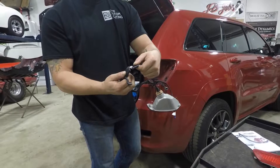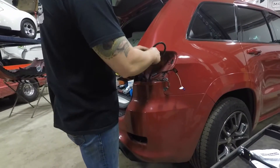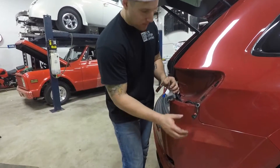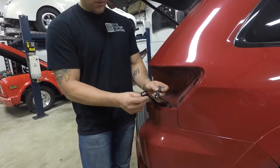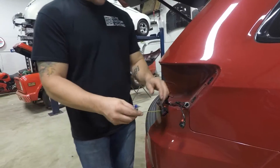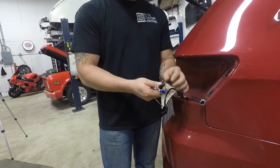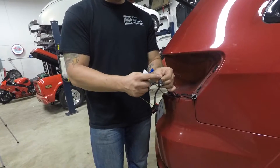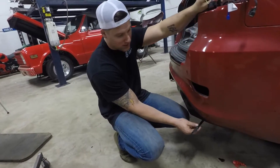Feed the connector that goes to the additional brake light down there as well. Just wiggle the wires around — you may run into some resistance but they will fall through. So we have our wires tucked in the bumper: you're going to have your gray and black wires going to the tail light and the larger one from the harness — those are the three you want to keep accessible. Then you have your running light connector, and we're going to tap that into the black connector's white wire. That white wire may have a stripe, but it is the white wire. The other one will always be black for ground, so use the black connector with the white wire — don't get confused with the gray connector.